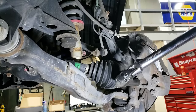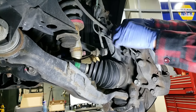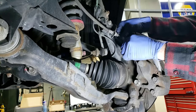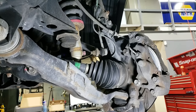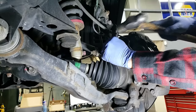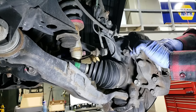Get those torqued at 91 foot-pounds and that's all torqued. Then we're going to reinstall the brake line clip. Being that it's usually pretty stiff, it's hard to get back in place — just kind of wiggle it, get it all lined up, look around the outside of it, and it will find its home. Slide the clip on and tap it back into place exactly where it was. The pistons are still retracted from before and we're ready to insert the pads.